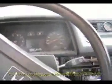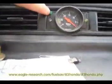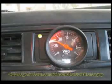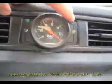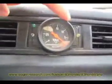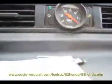We'll start with the dash. We've got the vacuum gauge there, and then this little green light here would be the deceleration fuel shutoff. I have a little switch so I can do it manually as well — turn it on and off. I used to have this mounted on the stick shift so I could manually turn the fuel on and off, but I've made that automatic now, so I put this manual switch off to the side. It can also work as an anti-theft device. This little blue light is for the hyzor, and the yellow light below it indicates when the hyzor is low on liquid level.